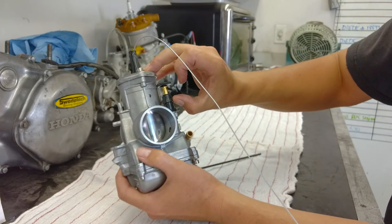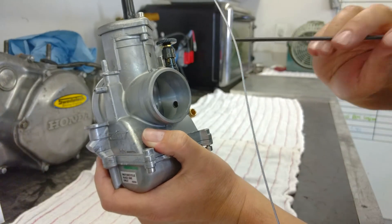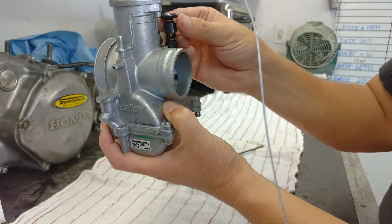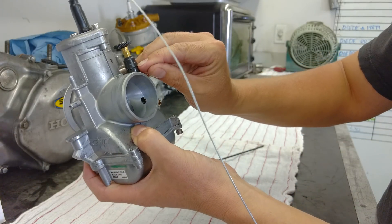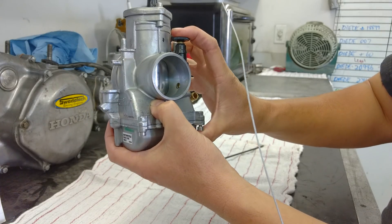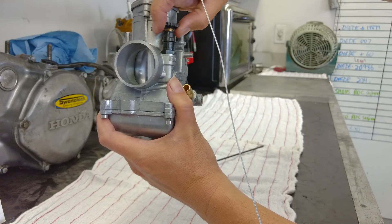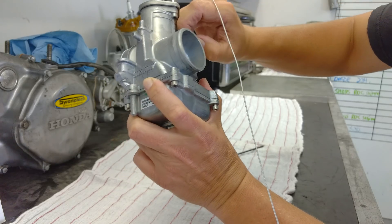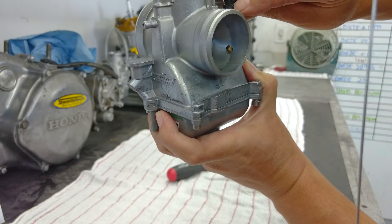The other item we see a lot is the little rubber boot on the choke. There's also a little rubber tip on there that needs to engage with the groove at the bottom. This doesn't happen very often, but I've seen it once where this was not engaged properly — the rubber was stuck on the shoulder and the choke was down, but up just enough to where the choke wasn't completely shut, allowing a little bit of an opening on the choke circuit. The customer was having problems with jetting. So make sure that rubber boot is snapped in over the choke valve body, and the rubber tip on the boot is engaged with the notch on the choke valve.